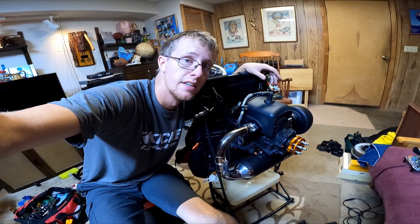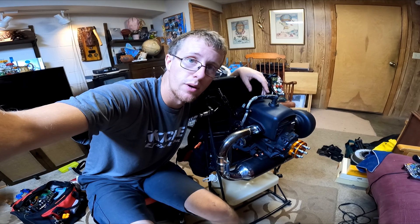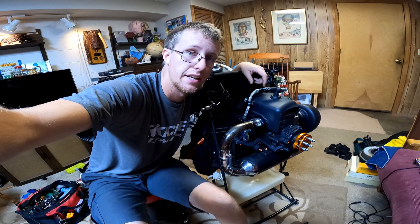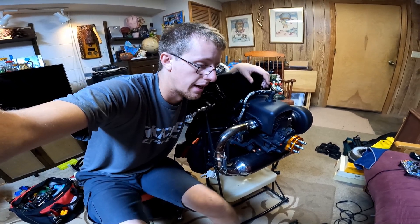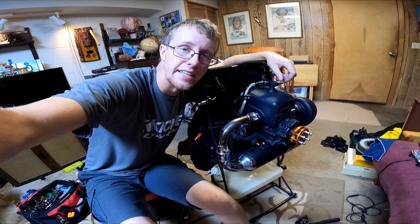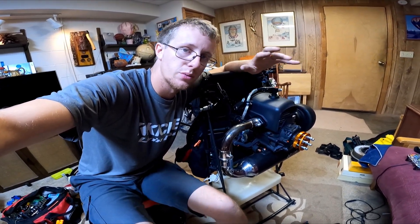Hi everybody! Thanks for checking in today. I've got a really quick one for you on improving your radio communications, potentially. If you've watched much of my channel, you know that I fly quite a bit from private airports, so I usually carry an aircraft radio and also a second radio for two-way communications with paramotors, and my phone playing music typically. All that means I want clear communication. When I first started out I got really nasty garbled static depending on my engine RPM, and it turns out my ignition coil — what actually makes the spark — was causing EM interference with radio transmissions.